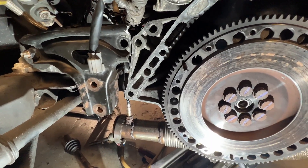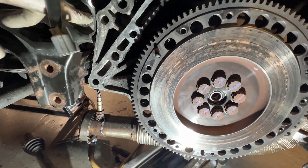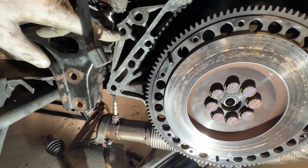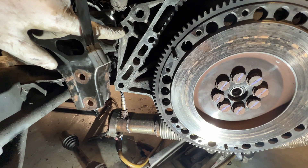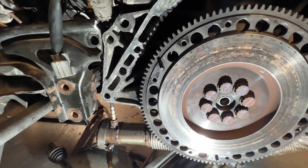So if you can see the bolt that's right across — the bolt hole is right across. Normally, this would be the bolt hole you'd use that goes into right here, but if you can see, it's about an inch or too short. So I cut this flush and I'm going to put a piece of metal on there, drill a hole first, put the metal on, then weld it on. Then I'll slide the transmission up and make sure everything fits. If both bolt holes go in, I'll pull it back off and lop off the other side and weld a piece of metal with a hole on it and put a bolt through it and weld it all back together.